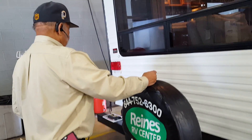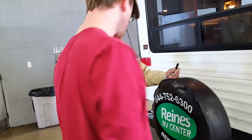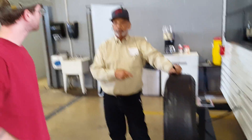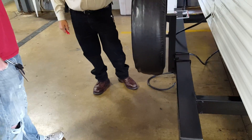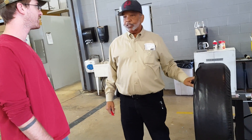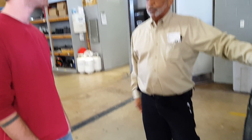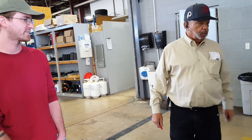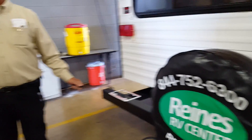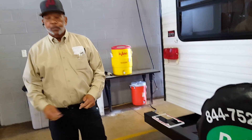This is your spare tire with a cover on it. I recommend keeping it covered, and also covering the tires on the ground — whether with a custom tire cover, a tarp, or plywood. What you want to do is keep the sun's rays off that sidewall. Without cover, you can have beautiful tread but the sidewall will be shot. That's the biggest breakdown on RV tires. In 21 years, I've never seen an RV with tires worn out from tread.